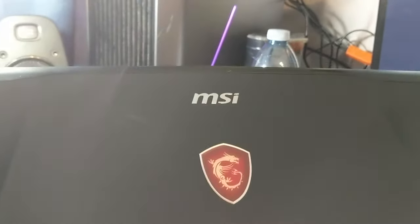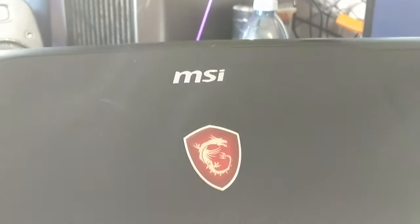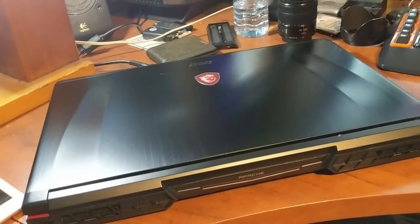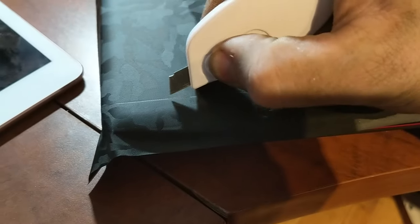We're only going to be wrapping the brushed aluminum piece — this is going to be a really easy wrap. I'm going to be covering MSI and using the heat gun to push down around the letters so it looks like an embossed effect. The emblem here I'm going to cut around. I was going to remove the emblem, but I didn't want to disassemble the entire display, because applying a ton of heat to the back to loosen the adhesive is not good for the display. You can see that crease along there — that's before heat gun and pushing. And this right here is after — a nice sharp edge.